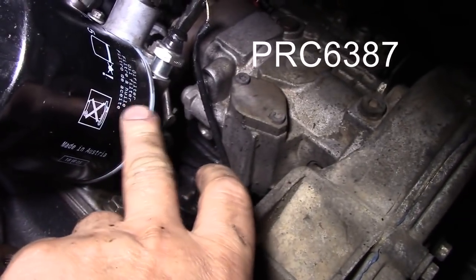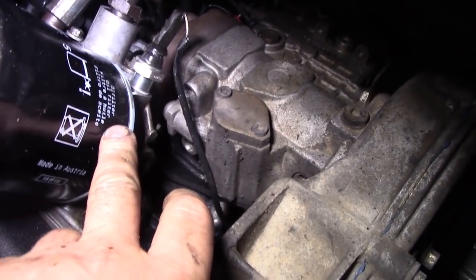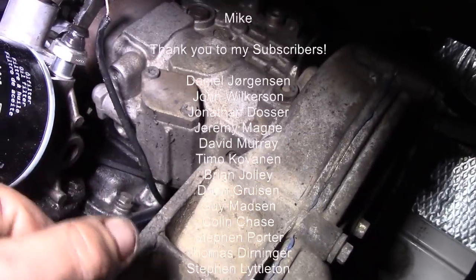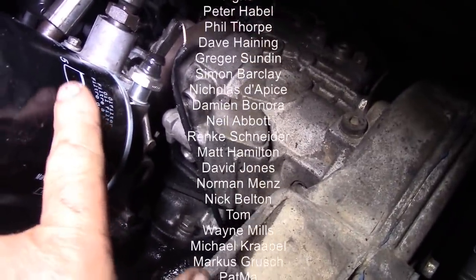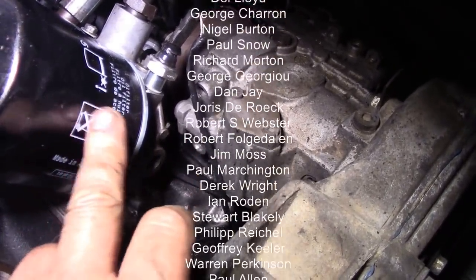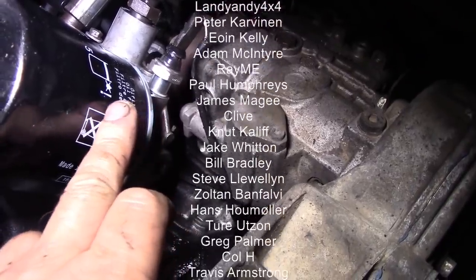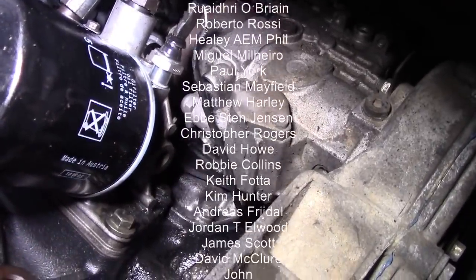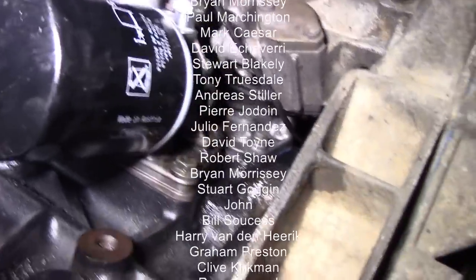New Mahle filter on, and I fill these full of oil before I put them on, just to give this engine a fighting chance of sucking oil into the crank. Never put these on dry. Always fill them up with oil. I know it's messy, and take your time, because you think it's full at the top, then it'll sink down. It's about 3/4 of a litre in there. Anyway, that's it. That should be leak-free.